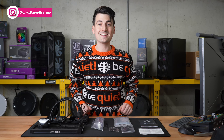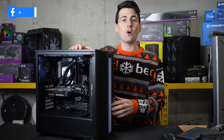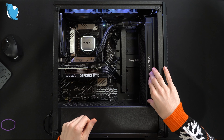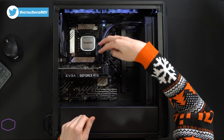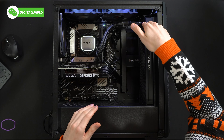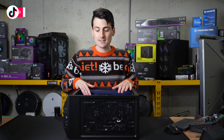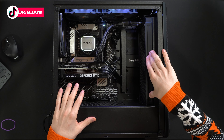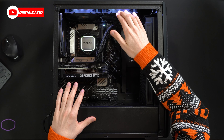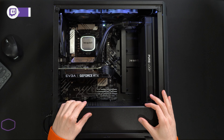Now let's get this installed. You can see we have the PC built and the cooler installed. We have the radiator mounted to the front panel and we chose to route it up top. Depending on your configuration — your GPU and everything else — you would be able to flip this around to the bottom. If you are using this particular case, you won't be able to mount the 280 millimeter version up top as it does not have support for it, but a 240 millimeter version or less would fit.